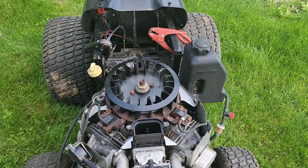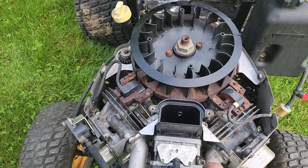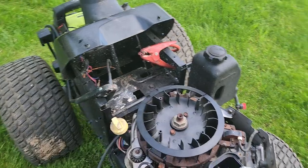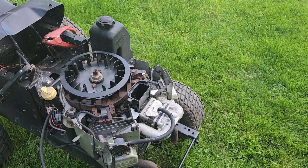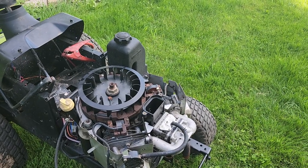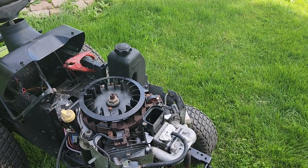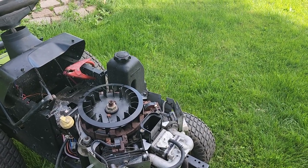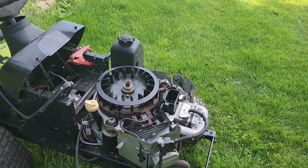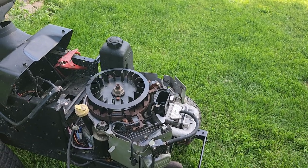I cleaned up the carburetor. I used the wire wheel to clean it up, because I had already had this carburetor RTV'd to the intake that this was on. This one was on a plastic intake before. The plastic ones do leak quite a bit as well — I do recommend a small layer of RTV. But I'd done that quite a few years ago. This carburetor came off of an engine I junked four or five years ago.